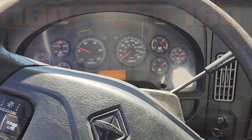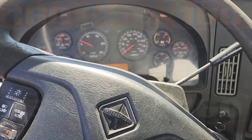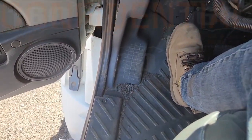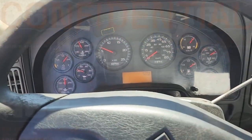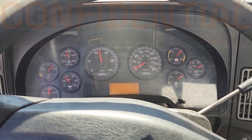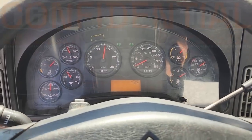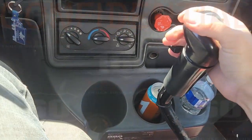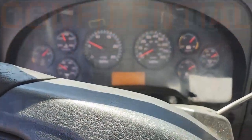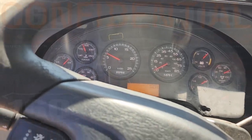This is a total view of the double clutching while moving forward. Be in your gear, gently let off your clutch to engage movement, bring up your RPMs to 1500, clutch in, neutral, clutch out, go up a gear. If you miss your timing, bring up your RPMs before clutching it into gear.